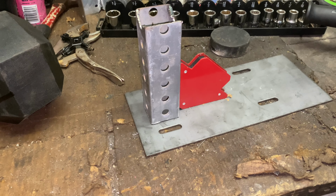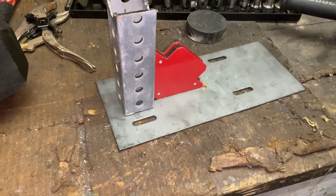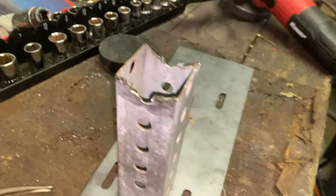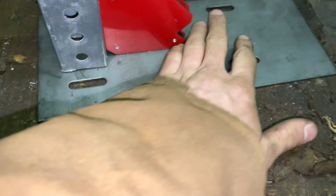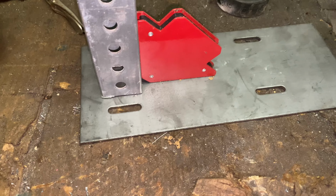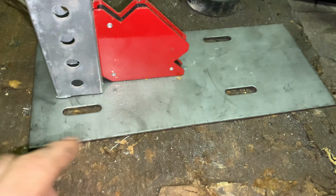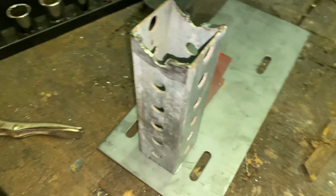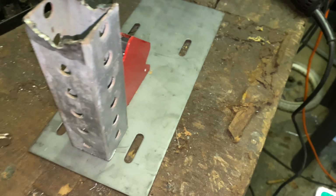All right, so I got the torque converter put up on the engine. And then, this is probably how it's going to look. This thing's on a pipe, so I actually notched it out a little bit to make it fit a little bit better. But this is just to make it flat. If you remember from the swing arm being a little bit slanted, I measured it out, and should be about level there. And I'm just gonna weld right around this thing, and then this is gonna get welded to the frame, and then obviously the engine's gonna bolt right up onto here.